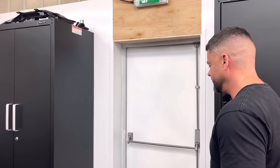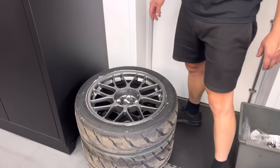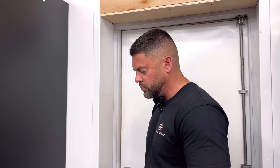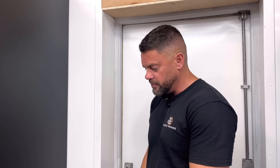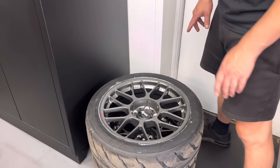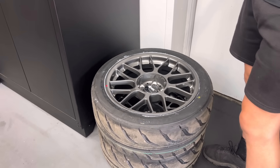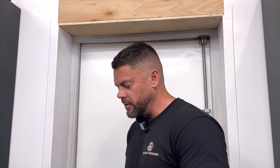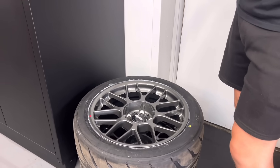What's on the floor behind you? Moving on to something a bit more important — these are the wheels off the E30, or that are going on the E30. So these are the front wheels that we showed you a few videos ago, brand new from Apex in America. The good thing about the Apex wheels is one, they're very light, and two, they're made to order — they do them in whatever offset you want, whatever width, whatever diameter. And these are a replica of the CSL. On the front we are running what most people run on the M3s, because we've got the Evo 2 Sport front arches, so we're going to be nice and roomy under there. These are a 17 by 8 wide and a 21 offset.